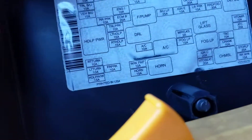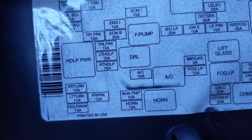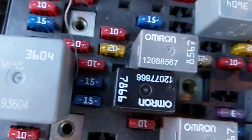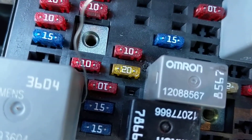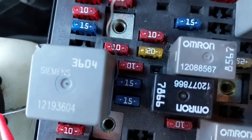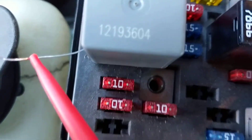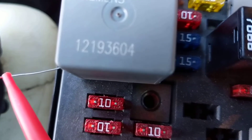Hello once again. I wanted to show you about the headlamp power relay — right there is the headlamp power relay. I did the same thing that I did yesterday. What I told you in the video was you cannot go and listen if the relay is on for the fuel pump or anything like that. Listening for a click is not the best method — the best method is to go and measure it to see if it works. So I took one terminal, which is the output of the switch, and put a lead there, then took the other one and put a lead to the other side, the terminal — this is the load side of it.